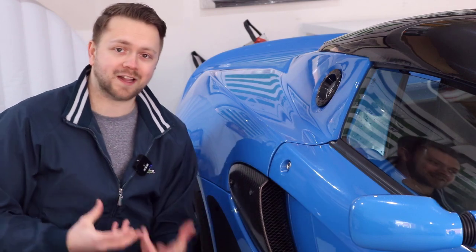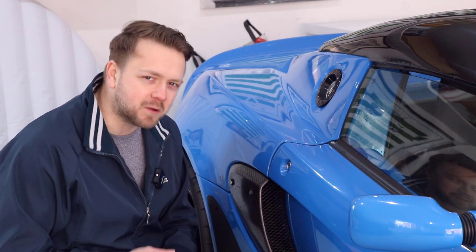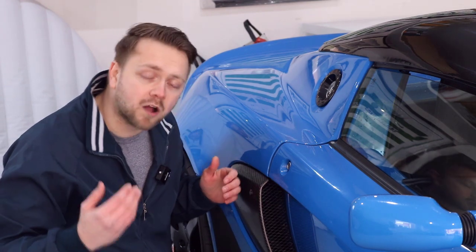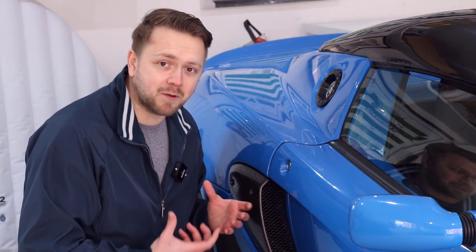Onto the job no one really likes when viewing a used car — we need to get down and have a look at the underside. On the Elise this is imperative, because the bonded aluminium tub and subframe setup, which was revolutionary at the time and helps keep the car's weight down, also responds really badly to crash damage. Look at each corner and make sure there are no obviously new components fitted underneath. Worst case, if you need to replace the tub or rear subframe, that's going to be really troublesome — because according to Lotus, they actually lost the jigs for these components.